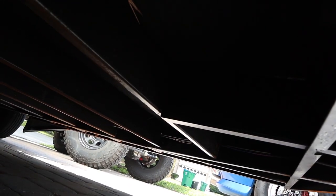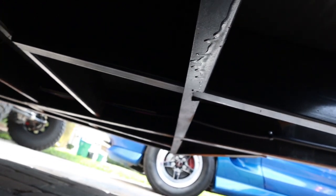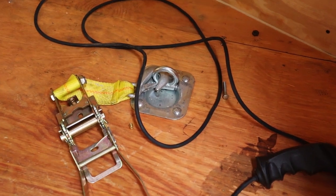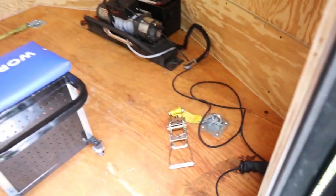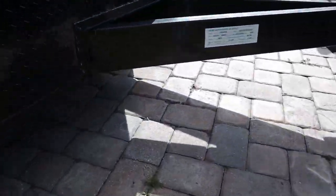Alright, so as you can see, it's metal with the wood flooring, so we're going to have to figure out how to mount it to make sure that thing can hold three, four, five thousand pounds. After getting underneath and reviewing what's under there, you can see the tie-downs are also underneath — it's kind of a pancake sandwich mount. It's basically a piece of metal bolted down, and that's what gives it its strength.